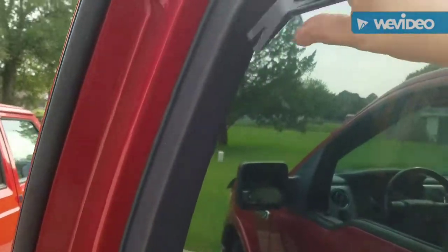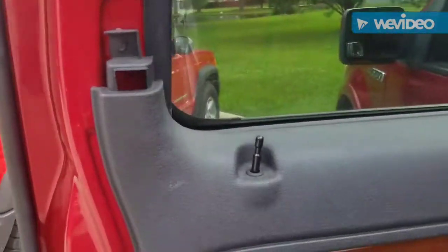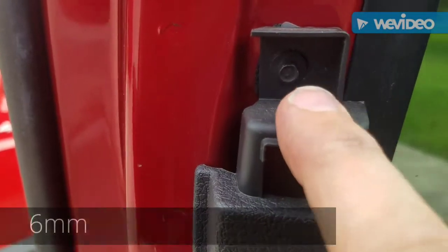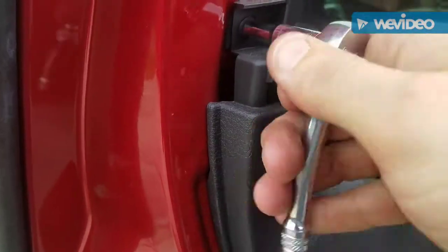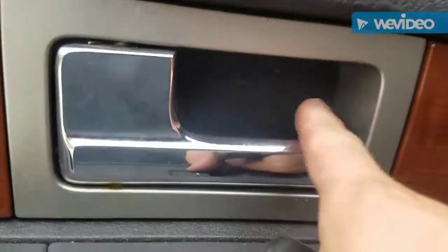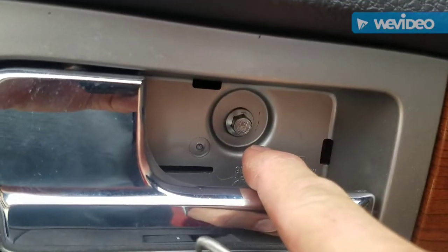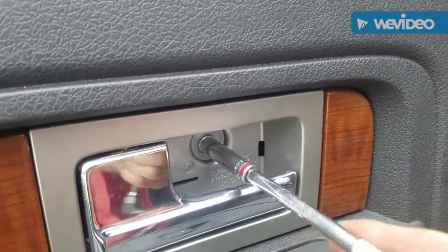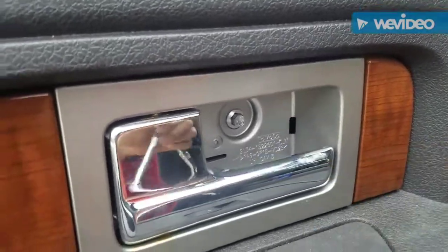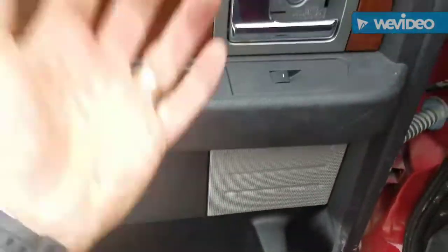For the second time, first thing you want to do is pull this piece off here. This pops off and there's a bolt right here — I think it's eight millimeter. It's actually a six millimeter. You've got one there, one here, and one here. There's a 10 millimeter behind this little plastic thing, and the way I got it is I use this little pick and pull this off. It's actually an eight millimeter.